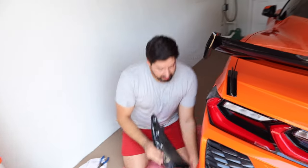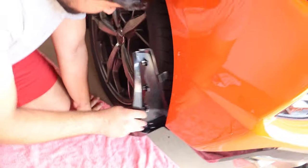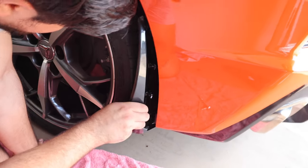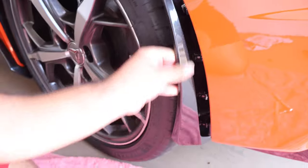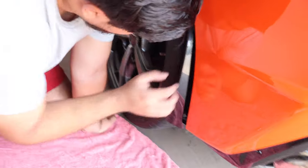That's pretty clean. We've got the two on over on that side. The front is definitely easier than the back. You just pop this one off, and then you just got to make sure this tab pops in here. All these will slide in right like this, and these tabs will pop in. The interesting thing is that the front ones are way easier than the back because the back you're pushing it into plastic, and the front you're pushing it into metal, so it just pops in way easier.